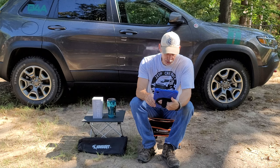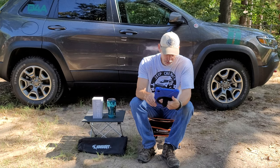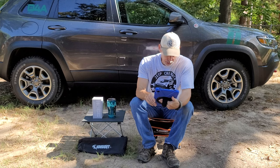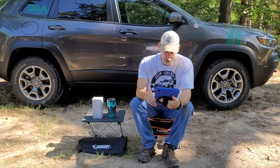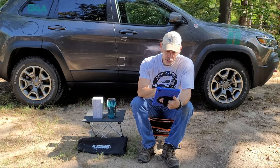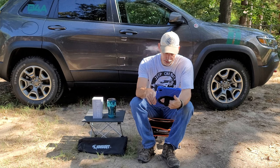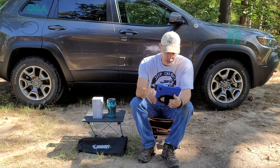It's got a rack and pinion steering. The turning diameter radius curb to curb in feet is 38.1. Has a struts multi-link suspension. Four-wheel disc brakes. Let's see what else I think is relevant. The front wheel size is 17 by 7.5. It's running P245-65R17. Well, they have P245-65TR17. Rear wheel size is 17 by 7.5, which is also P245-65TR17. The spare is a full size with a steel rim.